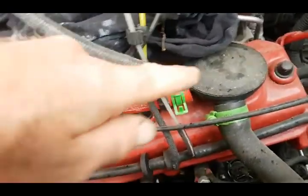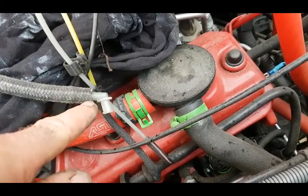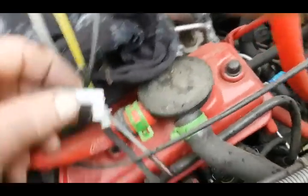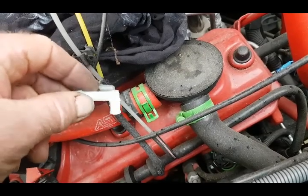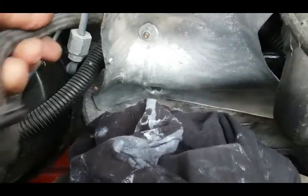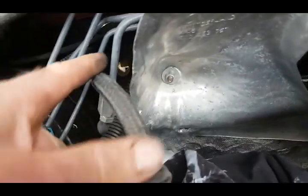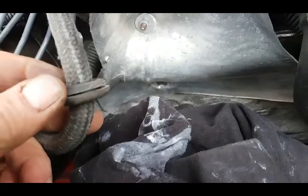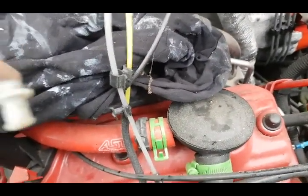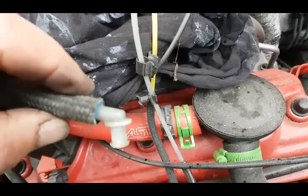What I'll have to do is put pliers on there and some pliers on there, maybe a little bit of WD-40, and then keep doing a twisting motion to twist that out. Then I'll push the new one in like so, about the same level. That will go pushing through that hole in the bodywork and then you just push the grommet thing back in. It's easier than struggling under the footwell where there's not much space and you can't really get to it — now I can get to it easy enough.